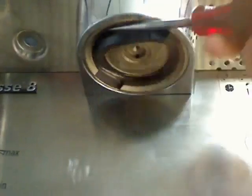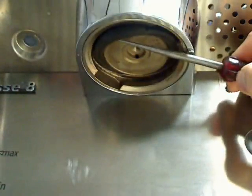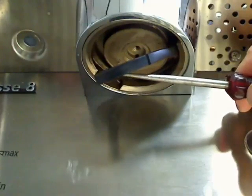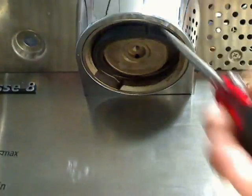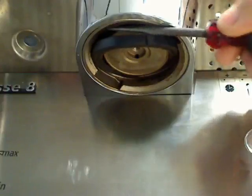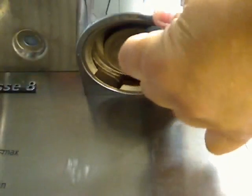And here's where, if I have a dental tool and the gasket starts to snap out in pieces, I can carefully get up in there above the gasket and pry piece by piece all the way around. So I'm just going to pull this out because it's nice and soft. This gasket's probably about 2 months old, 2 months of use. I pulled the gasket out.